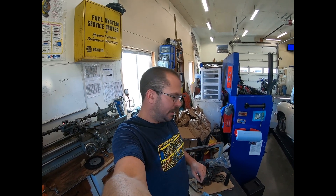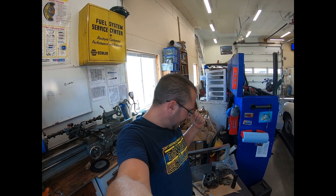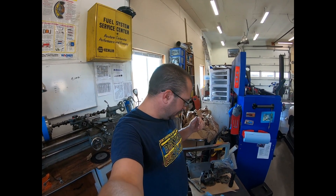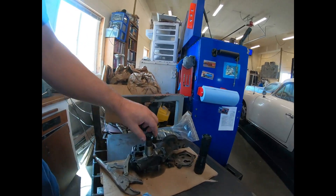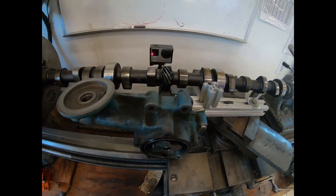I had a comment about a possible reason for oil pump failure in a slant 6, and I thought I'd walk you through some of the things I found on it and why that massive amount of silicone on the gasket really wouldn't have done anything with this particular type of design. These oil pumps are actually running what is called a screw gear setup.